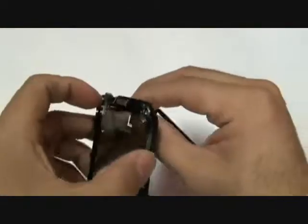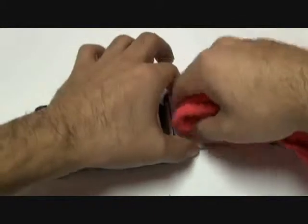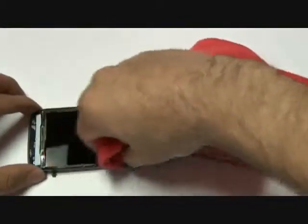Once the cable is properly through, you're going to go ahead and want to remove all the adhesive on the sides, the top, and the bottom, the one layer, so that you can safely apply it. If needed and you got fingerprints on your screen or LCD, once again just use the microfiber cloth to wipe those off before applying everything down.